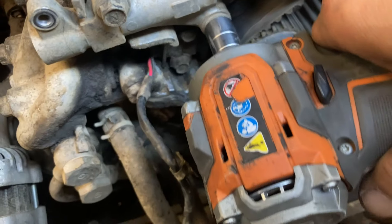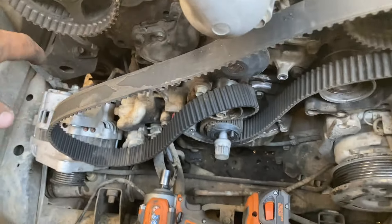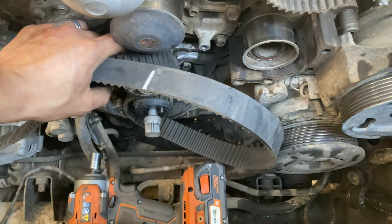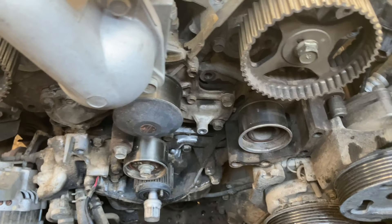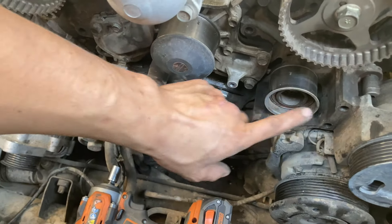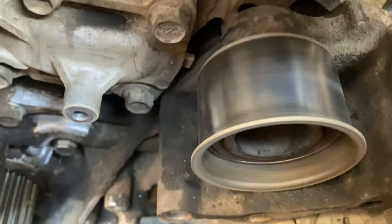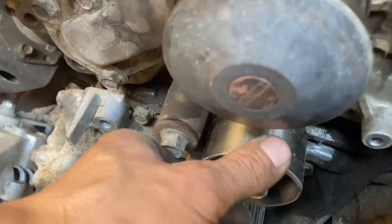I got the tensioner pulled out. Now I'm pulling out the timing belt, carefully getting it out of here. The next step is removing the timing components that need to be replaced — this pulley and that pulley mostly. You can already hear this one... yeah, that one's worn out. This one's pretty seized as well. They've just been in here for 60,000 miles, so time to get those replaced.